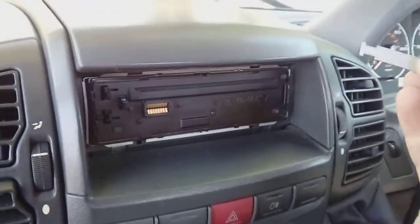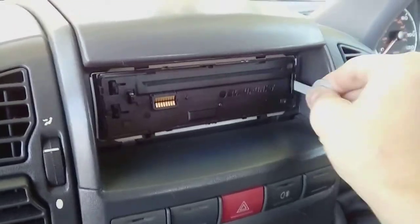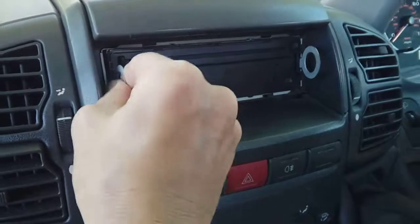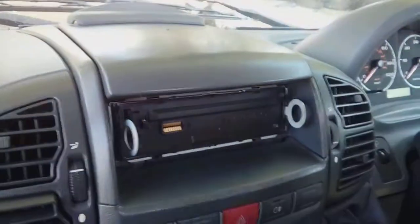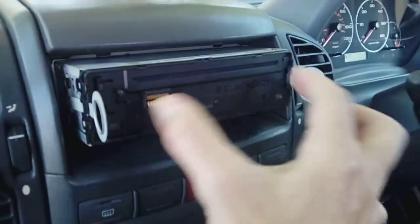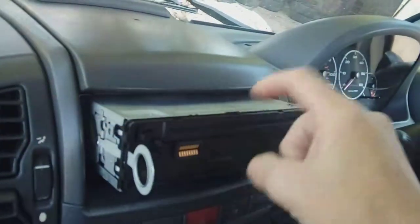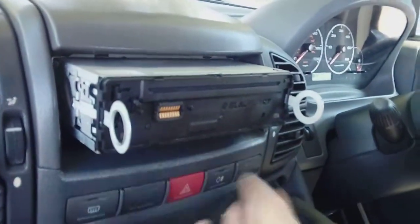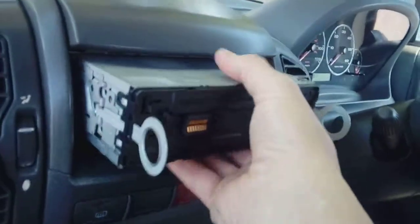Then your release keys normally just slide down in the right place. Busy looking at the camera and not what I'm meant to be doing! Click, click — you heard them lock. Pull. Just need both hands to pull these out. Just spread them slightly, push them apart so that you're ready to come out. Please note the back of it's metal — you don't want it to scratch anything, so just put something in between it, a rag or a bit of cardboard, and pull your radio out.